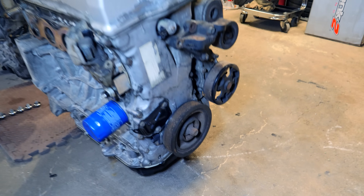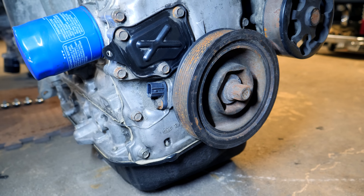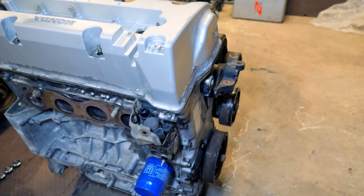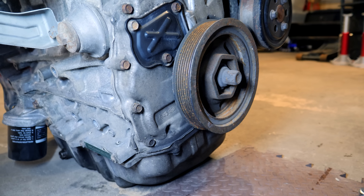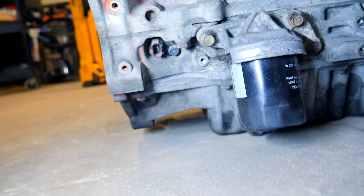Because both of these engines have distinct differences, I can't just put one of them in my engine bay and make 300 wheel horsepower. Before getting into the build process, let me tell you the differences between the two engines. First, the crankshaft position sensor on the A block is found at the pulley on the front of the engine with the accessories and the timing chain. On the Z engine the crankshaft position sensor isn't there — it's found on the other side of the engine, down below.